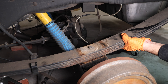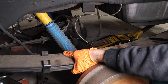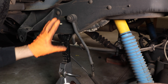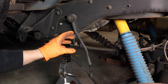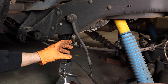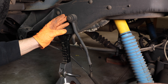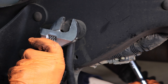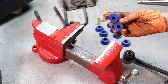As a side quest, I'm going to be replacing these rear sway bar end links — they're really worn out since these are original to the truck. They're very easy to replace in this situation since everything's already been removed out of the way. You can replace these as a whole complete unit or just the bushings themselves, which is what I'm going to be doing.